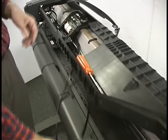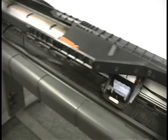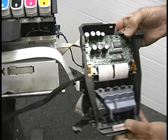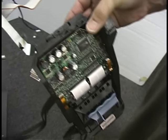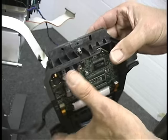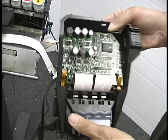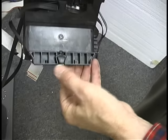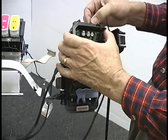The carriage is ready to come out of the machine, so I can just pull it through. You'll notice there are two bushings on the back — this flat one. If this gets broken or knocked out and not put back, your carriage height is off and you get terrible print quality. The spring-loaded finger that loads this can also be easily dislocated. So be cautious with both of those — they both have to do with carriage height.